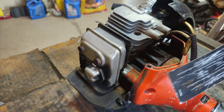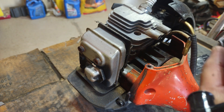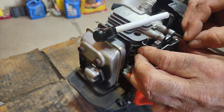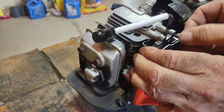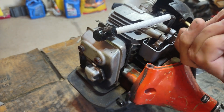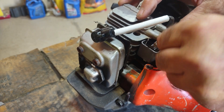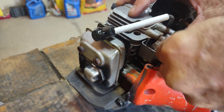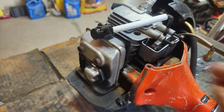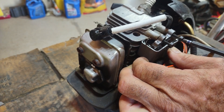Here's the replacement — same body color. He mentioned the blue one on his video had a rev limiter. Got a handy dandy business card ready to go. I'm going to put this new coil somewhere close to where it needs to be and get the threads started. I usually just reach down and rotate the flywheel with a screwdriver or my fingers to get it somewhat close, then push up on it to ensure a sufficient air gap.